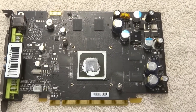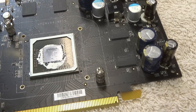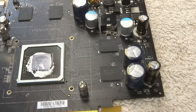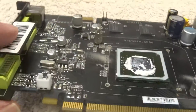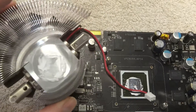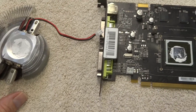Here's the video card after soldering in the new capacitors. It was a little tricky compared to a lot of them - it's a multi-layer board with large copper planes, so it was actually rather difficult getting the original capacitors off and getting the new ones put in, but with a little persistence, got it done. Now the next step is to put the heat sink fan back on and give it a test, and I'll go ahead and show putting it back on.